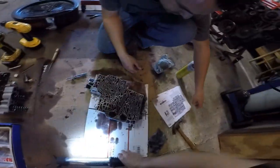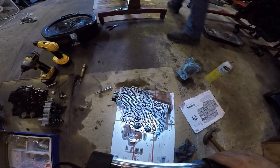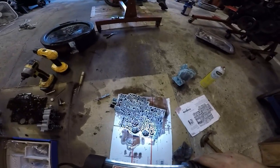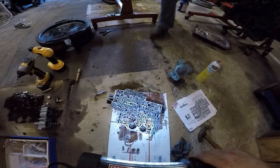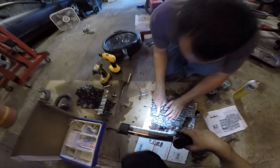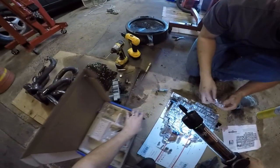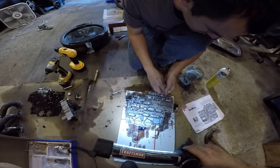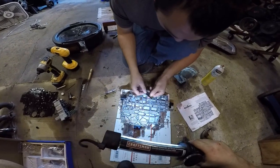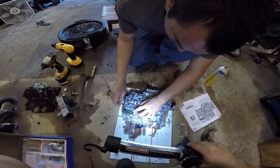Next page. Now we get to start drilling holes. You're gonna need two of the regular 10 millimeter valve body bolts. I welded that pan shut. Flip this over here, and you're aiming for this set of holes. This is like a pressure relief assembly, which you have to put together, and everything's small and tiny and oily. You take just the plate, and the Transgo piece goes to the forward side of the valve body, like that. Slide these two in.